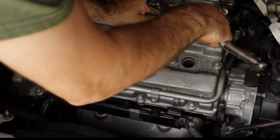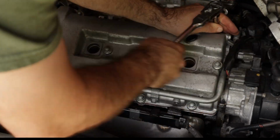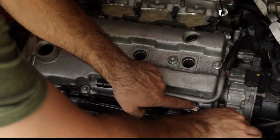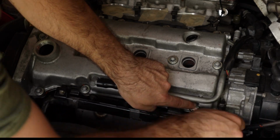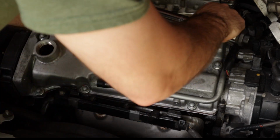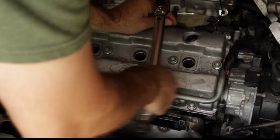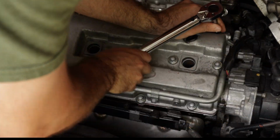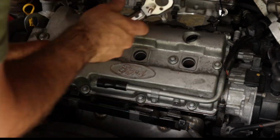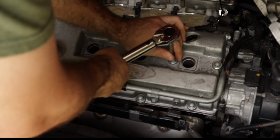Tighten each bolt evenly as you make your way around the valve cover, and do this over 2 or 3 passes. As an aside, you'll have to tighten this particular bolt with an open face ratchet since you can't fit a regular socket onto it. Once they're somewhat tight, you can torque them down to spec. According to the service manual, these bolts can be tightened anywhere between 43 and 78 inch-pounds. I torqued mine to 70 inch-pounds because I wasn't sure exactly how accurate my wrench was.